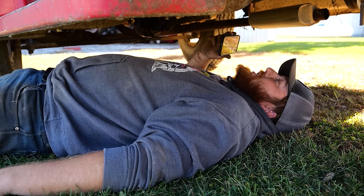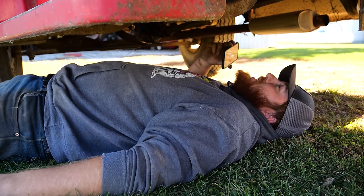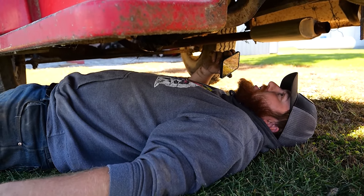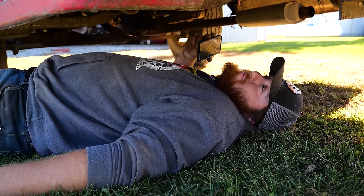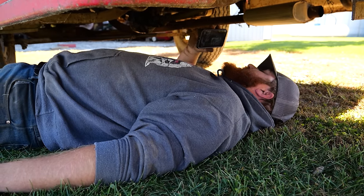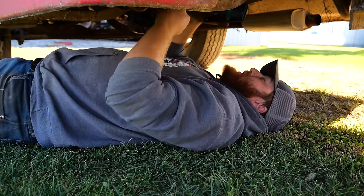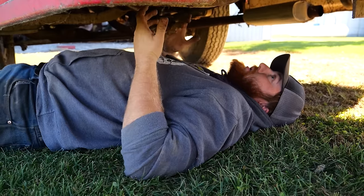What does it have for an engine, if you don't mind me asking? Is that Super Duty engine we were talking about? 391. Oh, it's an FT? Gross. Is that just the FE, but beefed up or something? The FTs are a modified FE. The crank snout on the FTs is a larger diameter because occasionally they'd have accessory drives for, like, air compressors and such. All right, have fun. Don't die. Can't promise any of that. All right. Thank you, Wyatt. Yeah, no problem. It's never good when the heavy truck guys say, oh.